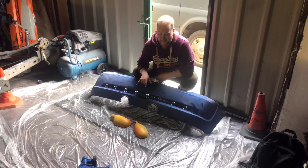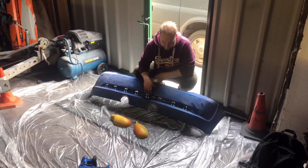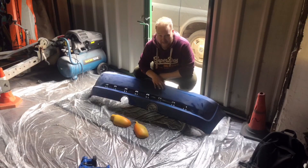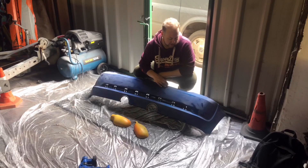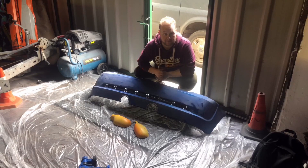I've now given the bumper and the wing mirror caps a quick key using some 800 grit sandpaper and given it a wipe down. I've used 800 grit because that way it literally just gives it a nice key so the new paint will stick to the old paint. However, you won't be able to see any scratches or marks left by the sandpaper. So I've given the gun a quick clean — now it's time to put some paint on.